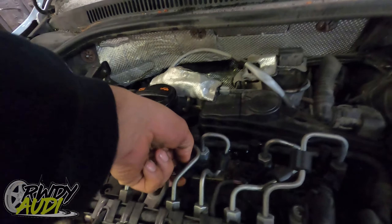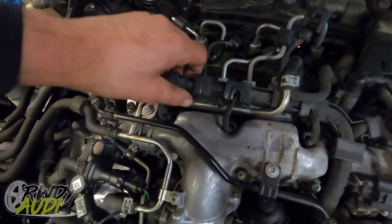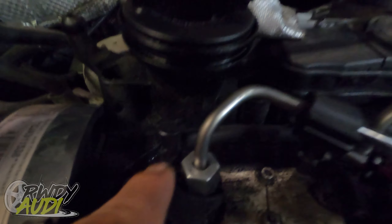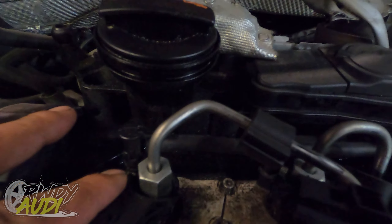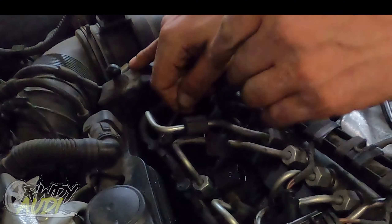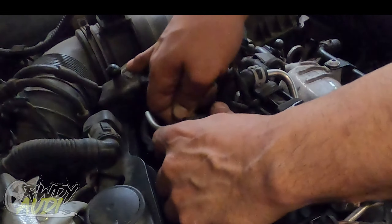So to get these things out, it's not that difficult. First thing we got to do is disconnect all of our electrical connectors — this harness will just pop up off of there. We need to disconnect all of these lines off of here, pretty simple and straightforward to get them off, and then all of these lines back here. So these retaining clips right here: the top goes up, the bottom stays in place. Kind of complicated sounding, but it makes sense when you do it.